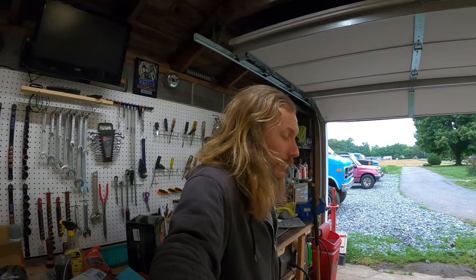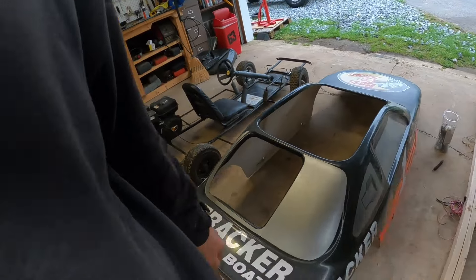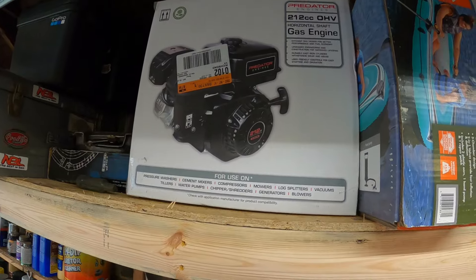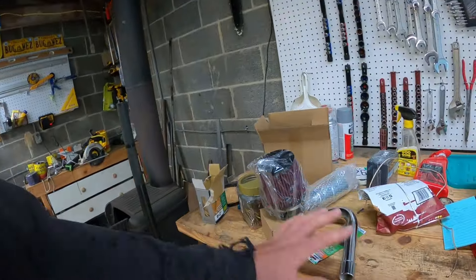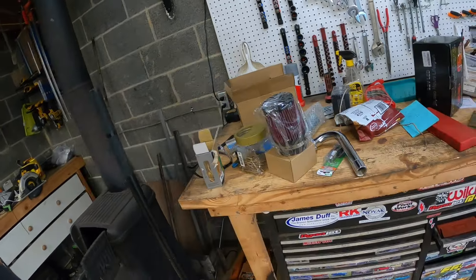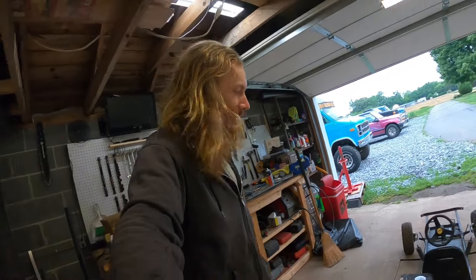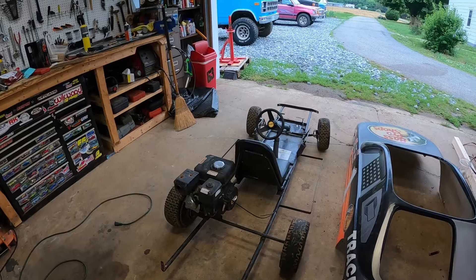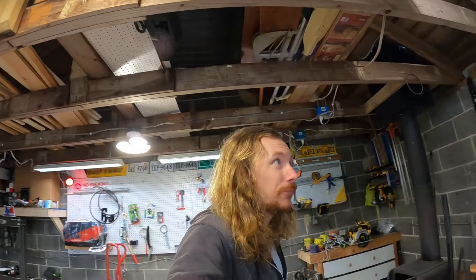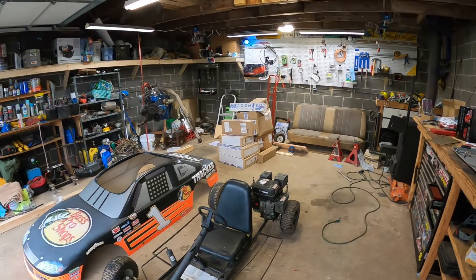In this video we're not going to make it a kids' NASCAR — we're going to make it fast. We are getting rid of this Jiangdong Chinese motor and replacing it with a Predator, another Chinese motor. It's a 212, six-and-a-half horsepower versus the current five horse. We've also got an upgrade kit: header exhaust, carburetor, you name it. The previous lap time was 1:18 and the top speed was only 18 miles an hour, so we'll see what we can get out of it with the Predator.